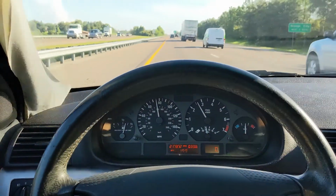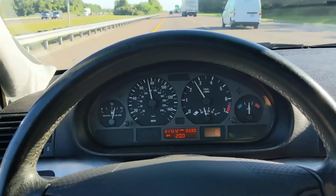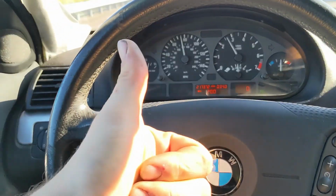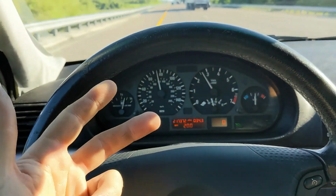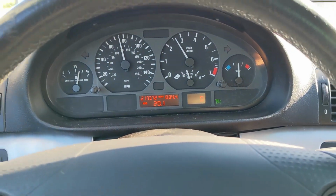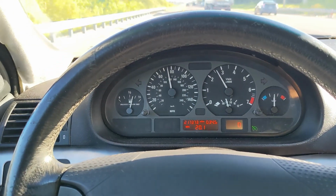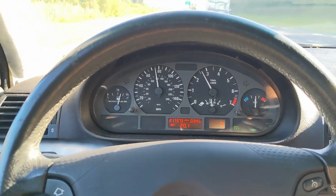By the way guys, I'm not usually the person to vlog and drive, but I just have to say that after replacing the DMTL pump and the oxygen sensor and whatever the third item was, I forget what it was, we've done about 34 miles now, check engine light free. So I'm hoping that we continue this streak here. We don't have any issues.